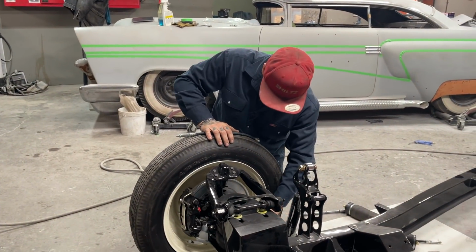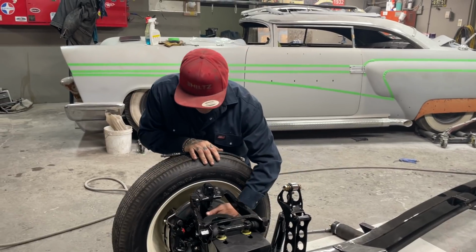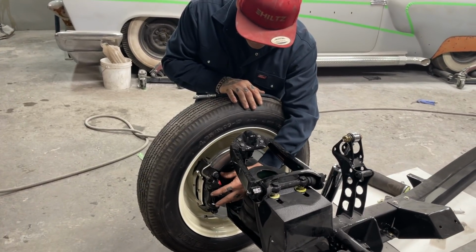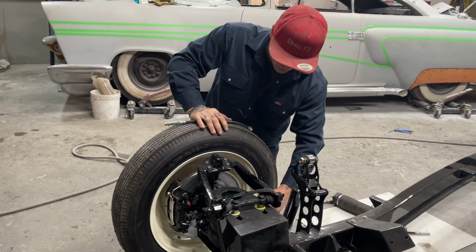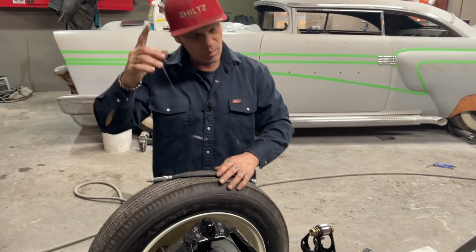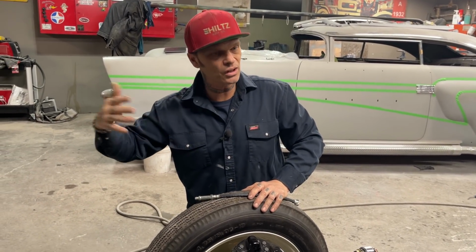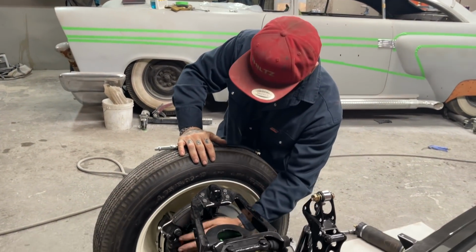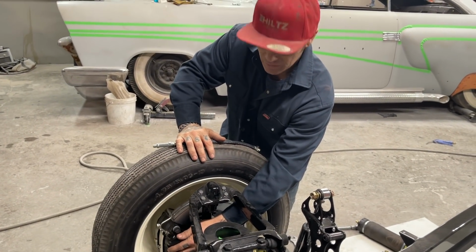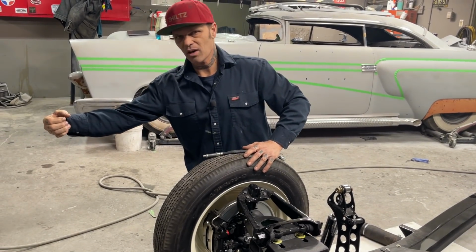But as I've taken the steering arm and have it on the back and have the rack on the back, when I went to apply the brakes with the kit that I had, the bracket that bolted on the caliper was on the opposite side of the steering arm. When I tried to put it on the back side, it did not work because of the steering arm. So basically, when I modified something or changed something, it just went toot, toot, toot, and it keeps going down the line, and it also went to the brake calipers. Also, there are cars that have the brake calipers in the front. Yes, there is. You have to think about it. Whether I squeeze the rotor from here or whether I squeeze the rotor from there, what is the difference?